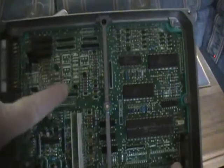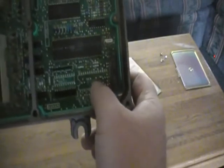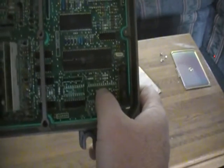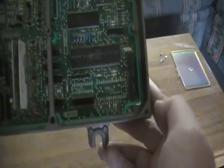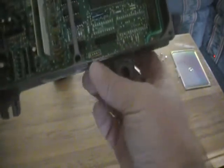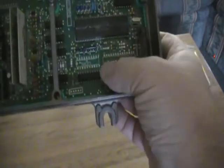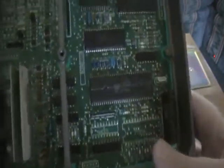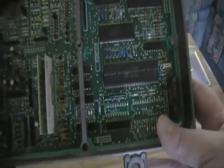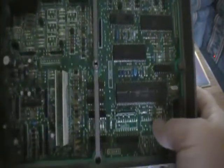You see some stuff up here — there are other things you can put in there. The bulk of it is you put in basically a memory chip right here, and I believe this is just a data buffer. You add a few jumpers, a few resistors, a few capacitors here and there. And then right here I'm going to put in a header, and this allows you to put a chip in here. You write your own program to the chip for how you want the computer to run — like what RPMs, whether or not you want your fuel and O2 sensors to kick in. And what speeds your VTEC solenoids. This one's not a VTEC one, but I think if you wanted to make it VTEC, you'd add some components up here.